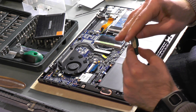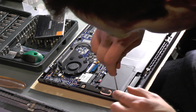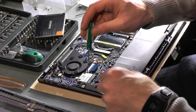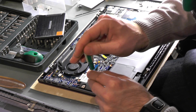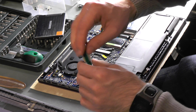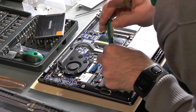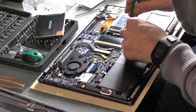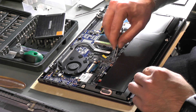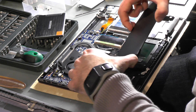Let me continue with the battery — we're on four of eight, halfway done. Then only two more screws for the hard drive and we're finished. You can also upgrade the tiny SSD, since Samsung now makes a large-capacity mSATA — you could put up to one terabyte in here. You could leave the 500 GB HDD for movies and just copy one or two to the SSD to reduce battery consumption so the hard drive doesn't have to spin constantly.